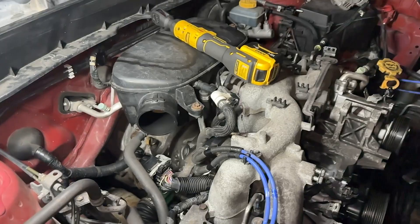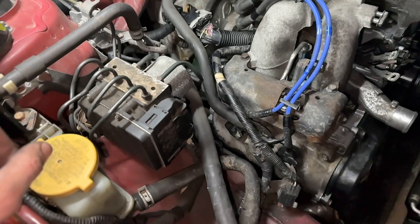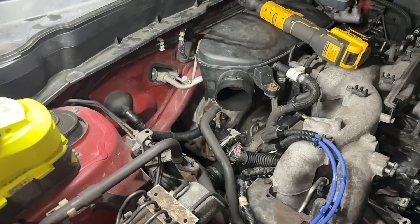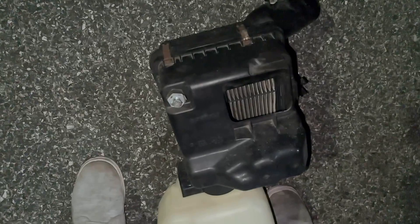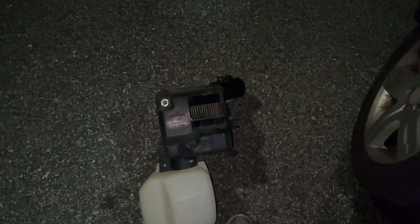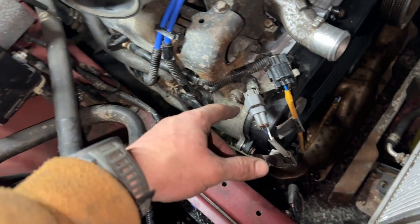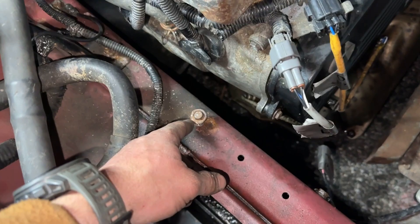Getting everything connected underneath before routing the main hose. The notch on the hose lashes into the nub, secured down with a hose clamp using an 8mm bolt. Last but not least, dropping the air box back in — it connects on both circular sides. Also clearing out and replacing the filter in the catch can at the bottom. Before the last piece, I mounted a bracket for the oxygen sensor connections. Air box secures down here and somewhere up top. Spark plug wires are routed and tucked in — looks good.